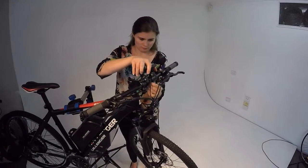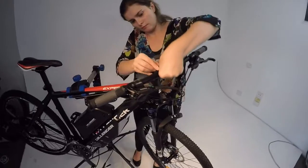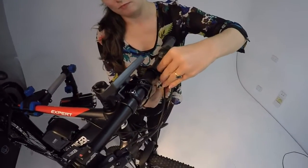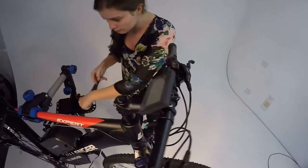The display is the final component that completes the install. The bar clamps are fitted over the handlebars and are fastened using the bolts provided. The thumb controller is fixed beside the user's left hand. A thumb throttle and motor inhibitors are included in the kit, but are not necessary to run the bike.